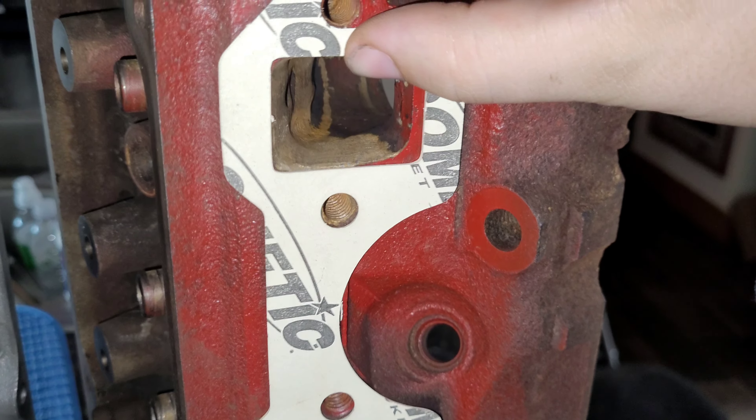Now let's check out the exhaust. The exhaust is where we spent most of our time with the porting on these E7 heads. We raised the exhaust ports up to match our gasket and widened it to match our gasket. That's how much overhang we had up here to begin with. We didn't touch the floor at all, because exhaust gases get shot up and are trying to come out this way — it doesn't really care about what's on the bottom as much.